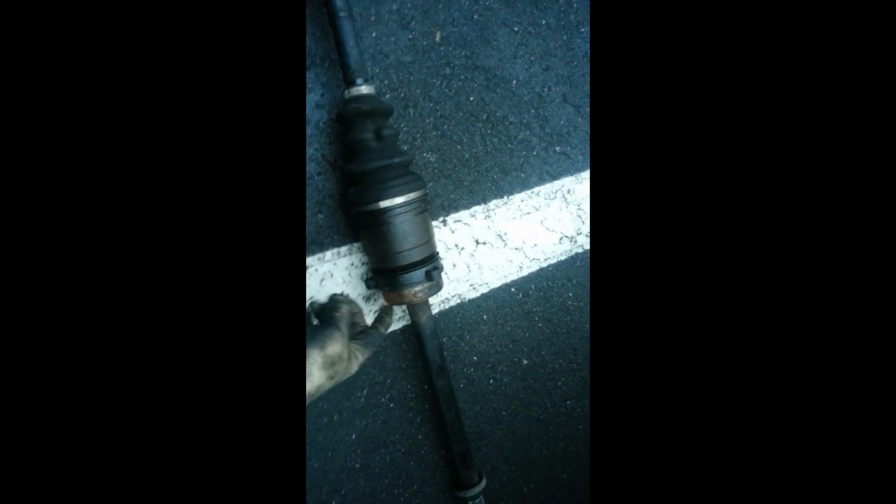And then the way I got these bolts off, the bolts come through on this side when you're looking at the car this way. So you're going to reach back there with your right hand, and the bottom 2 are pretty easy. It's 12mm bolts, and I used a ratcheting wrench. You can use a combination wrench. And then the other one, I came from the top. The bottom 2, I came from the bottom. The top one, I came up with my ratcheting combination wrench.